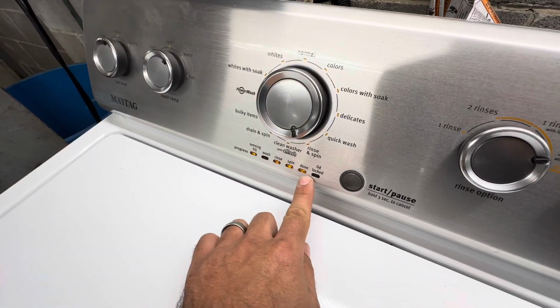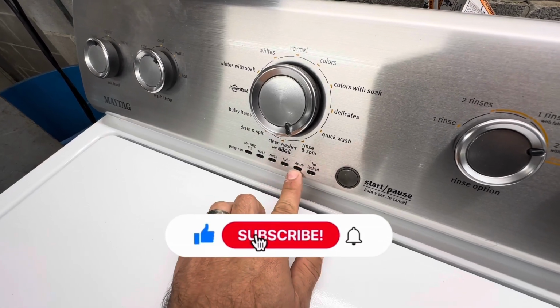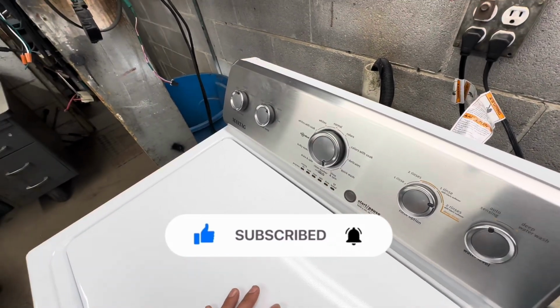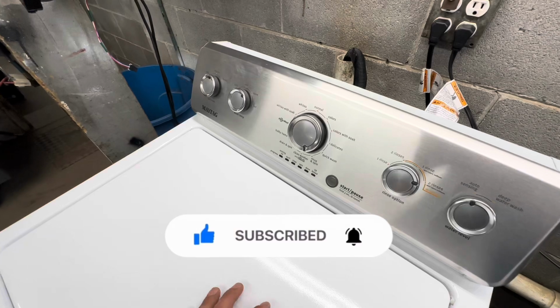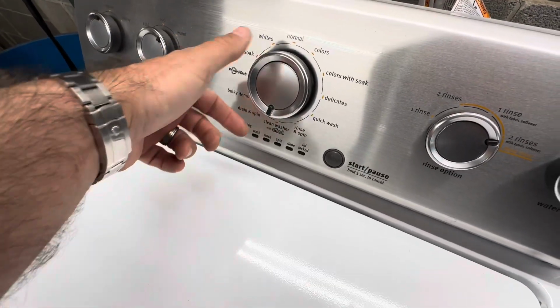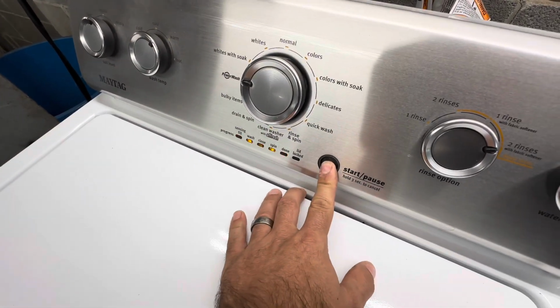That's an F7. 1, 2, 3, 4, 5, 6, 7. F7E1. That's the tachometer speed sensor. So we need to do the tach test. Yep, F0E0, nothing else. Now with all of them lit, you clear it by holding it.